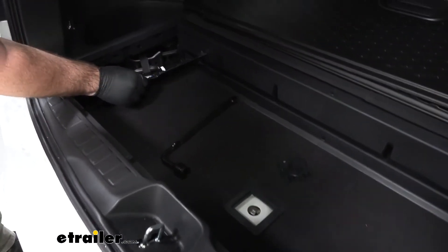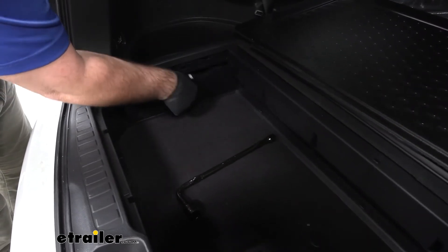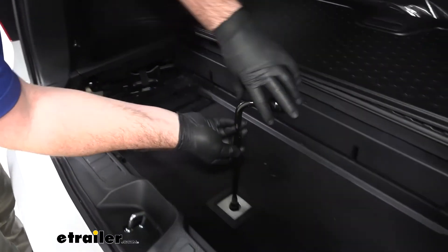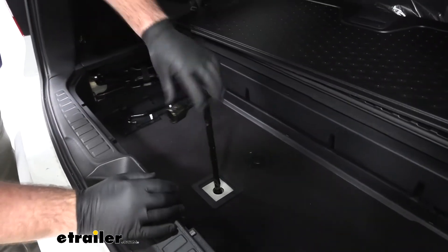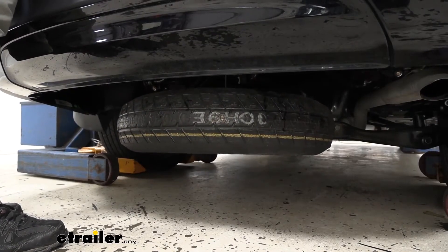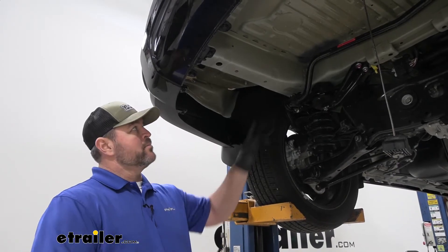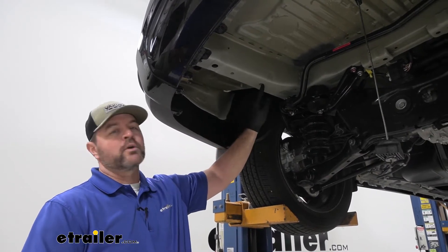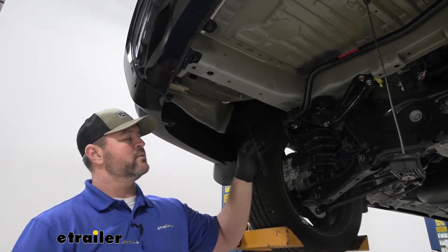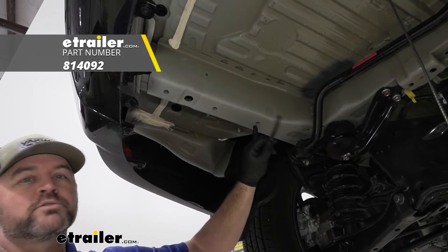Come over to the driver's side. This panel right behind it is where your spare tire tools are. Pop this off, and on the lid you're going to have this tool. Slide the end on and then just turn it to lower your tire. Now, this is a brand new vehicle, but our mounting locations on our frame rails are open to the elements. So if you've driven your vehicle for a little while, it might be a good idea to take a nylon tube brush and clean out the threads, because we don't want our hardware to cross-thread inside of there.